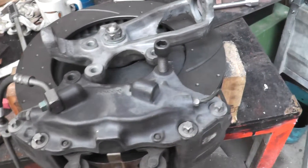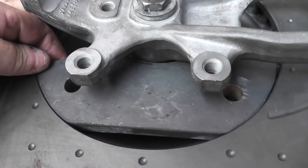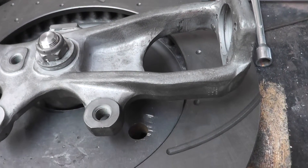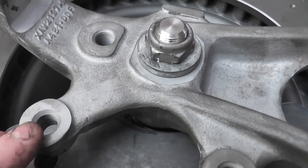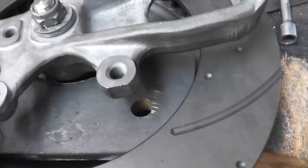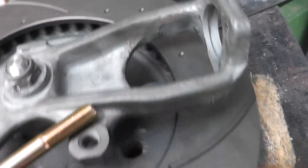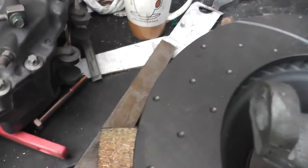I've got a second one here — the brackets have been drilled for the caliper at this point, but I've still got to do the final fit-up on this one. These threads here, like I said, they're drilled through — threaded originally but drilled through — and with the spacers, drilled and tapped into the plate, all tightened up really nice. Half-inch UNF bolts going through, pretty strong.